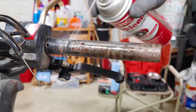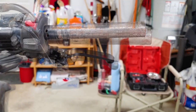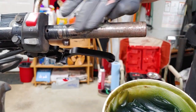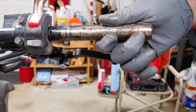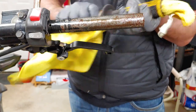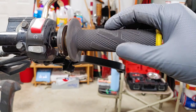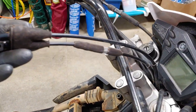This is a good time to clean and relube the throttle grip. I wiped off the dirt and used brake cleaner to remove any old grease, but I probably could have gotten some of the rust off with steel wool. Only use brake cleaner in a well-ventilated area. I used waterproof grease, but the service manual says to use lithium soap base grease.